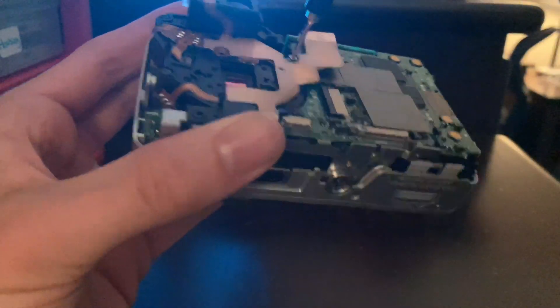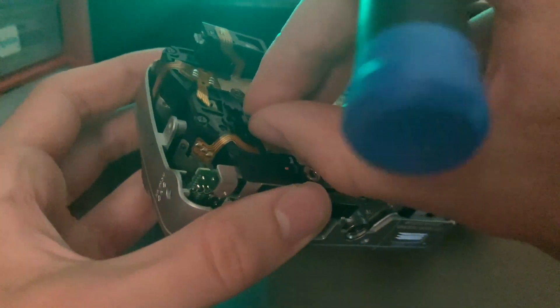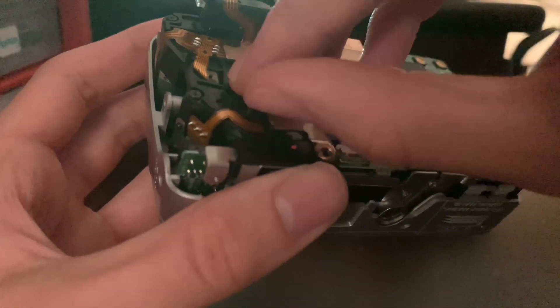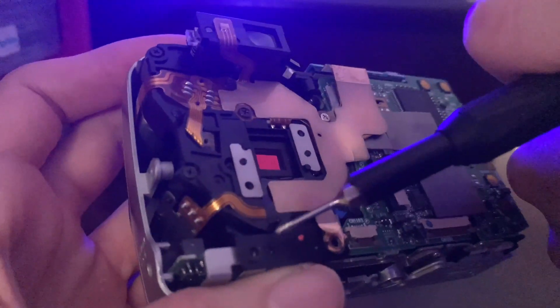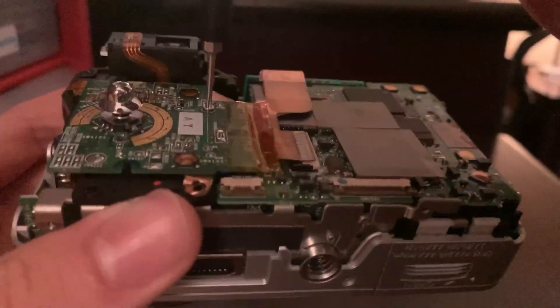That's as far as I'm going to go. When I put this back together, I know I'm not going to put all the screws in the right spot, so don't hate on me for that — I hit it with my arm and don't really remember where all the screws went. These little metal plates: the smooth side goes down and they have to fit in with pins on the bottom that go into the holes, so it only fits one way — you'll know if you get them in the right way. There's a little pin on there that helps you line up the logic board for the controls, which you can easily just put right back on and screw the screws in again, holding that down into place.